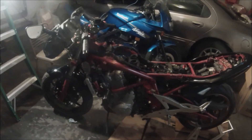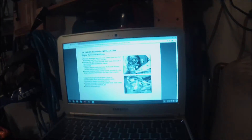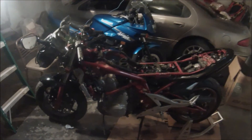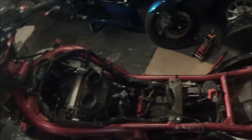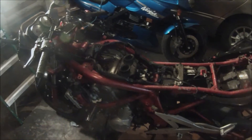After they left I put the radiator on and I put the chain on. I've been working on the breather box - all I have is this little manual here. I've been using this manual and also looking at videos on YouTube of people working on their 2006 Ninja 650. Now all I got to do is connect all these electrical connectors, then put the battery in, then the air box, gas tank, seat, and start putting the fairings on. It's getting close - hopefully this thing will start and run. All right, let's get busy.